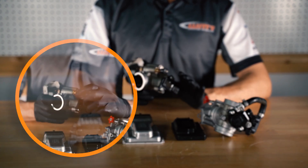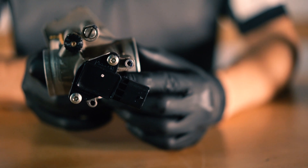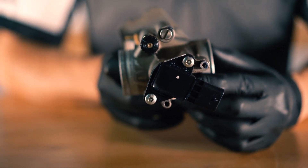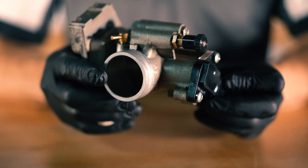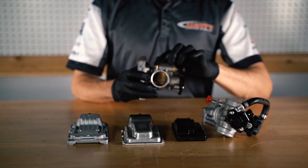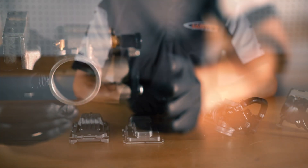After the bike has reached operating temperature, you'll have to manually release it by twisting it halfway. You also have a throttle position sensor on the left-hand side, and another important feature of this throttle body is this oil injection port. This is what allows two-stroke injection oil to drip into the fuel and air charge rushing into the combustion chamber.